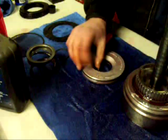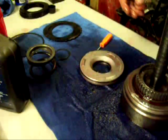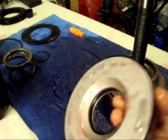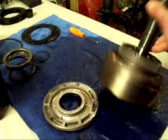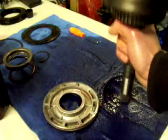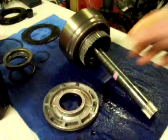Kind of a pain to get these inner ones in. I'll shut off the camera so you don't have to watch the whole thing. Well, I got it in. It's like 20 degrees out here so the seals aren't very flexible, but it's in — all good. Now I'm going to take this whole unit over to the vise so I can go ahead and put the clutch packs and the piston in and everything.